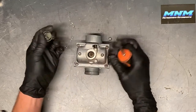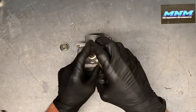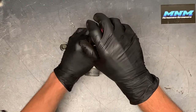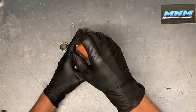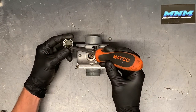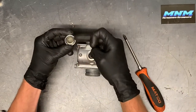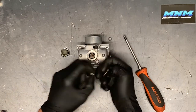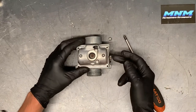You can pull this bottom bowl. I had it finger tight just to show you what it looks like underneath — you're going to see your main jet. If you're trying to re-jet for performance, you can pull that cap and replace your jet from that position without pulling the bowl off. But for a good carb clean, I suggest pulling the bowl so you can clean through all the jets and blow through all the ports. A lot of the debris will sit inside this cap too — clean that out really well and make sure the o-ring is in good condition. There are four Phillips screws — don't over-tighten going back together, it strips them out.